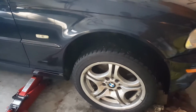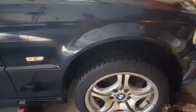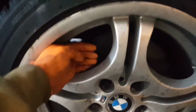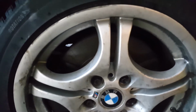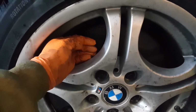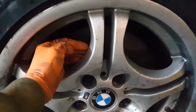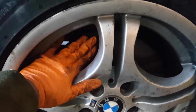When you come back, you will certainly have applied some brake on your car. After a 1 minute or 5 minute journey around the area, come back and repeat the same thing again. Tap lightly on the disc brake. The reason why I ask you to tap is because sometimes if the caliper or the entire disc braking system has an issue, this metal plate, the disc brake, could be very, very hot. By tapping it, regardless of how hot it is, unless it's burning red, you should be able to feel it. If the temperature is okay to the touch, then you can hold it much longer to get an actual temperature feeling.